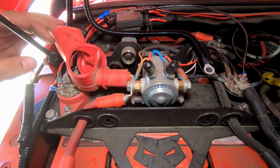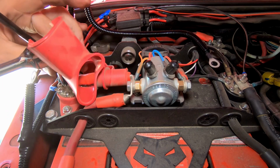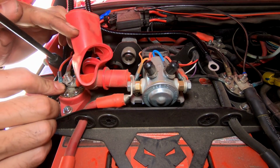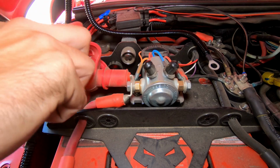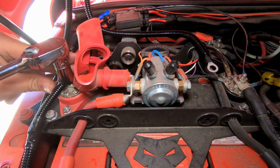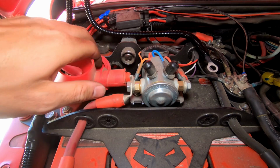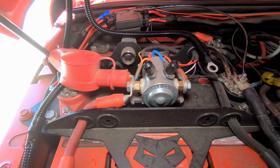All right, let's connect our ring terminals onto our battery now. And like I said before, make sure that the switch is in the off position. The only reason why I used this top post on the Genesis system was because the rings that they include on the wiring are so large, it just wouldn't have been a great fit with one of these smaller posts. And I might switch that out later, but just for now, that'll work.